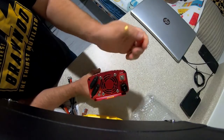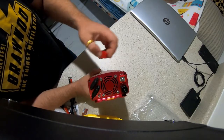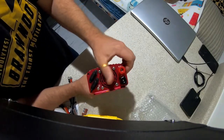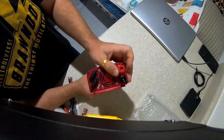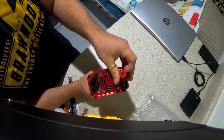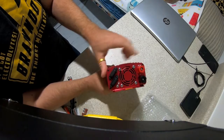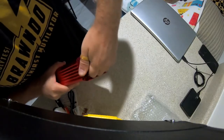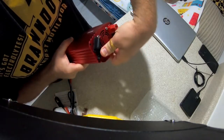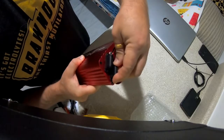We've got female terminal ends and your terminal connections. There's no divider between them, but I use a lot of heat shrink and make sure everything's shielded — I've never had terminals like this touch, so it's not a problem for me. There are two user-accessible fuse holders, which is nice. The fuses are 40 amp and a little bit of a bear to get off, so they won't fall off while you're using it.